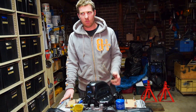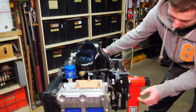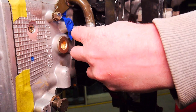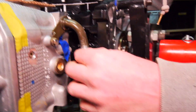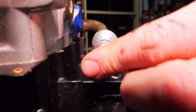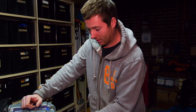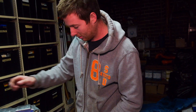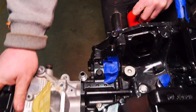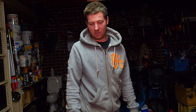Alright guys, so two days have passed — 48 hours later, coming back to the motor we can have a look at this oil drain. That JB Weld has gone rock hard. That is seriously as strong as a weld, like it says. I'll spin the motor over so you can hopefully see through there — it's all nice and clean. You definitely need to do the earplug trick to clean out the center so no crap builds up inside and restricts the size. Hopefully there's enough room to get a spanner in there to do up the AN fitting.